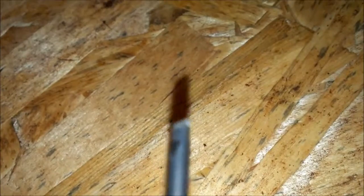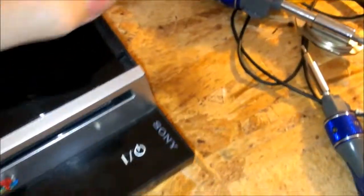like a star bit. What you want to do is take a small flathead screwdriver like this and push really hard and then turn it out little by little. If you have the special bit, you can go ahead and use that, but most people don't. Pretty much any kind of small eyeglass screwdriver set will work. Then you just slide that top cover to the left, and it will pull up off in here.